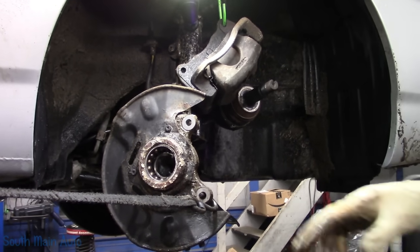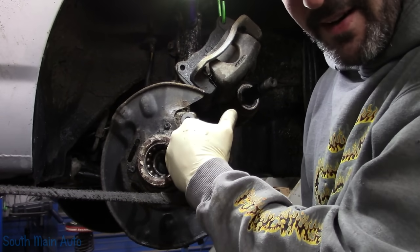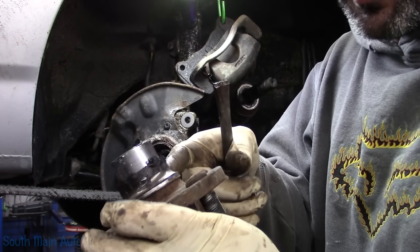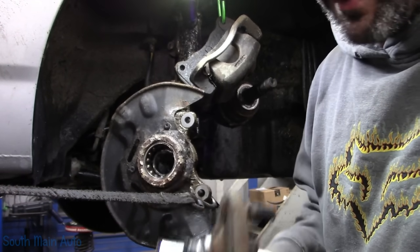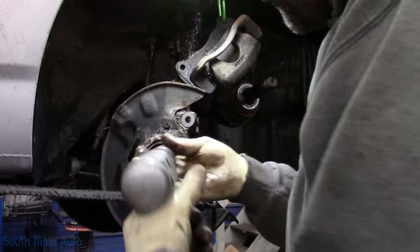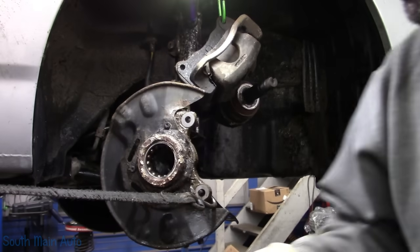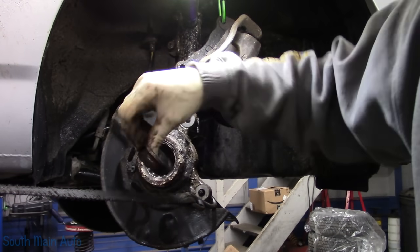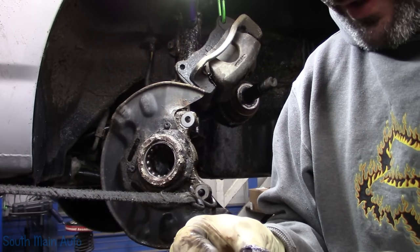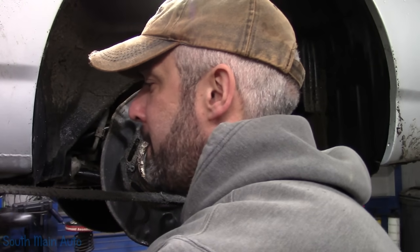So I'm gonna do it now because we're gonna use the hub tamer or hub grappler to push this out. But I need this bearing race. And I bought a whole hub kit for this one. Because typically, or otherwise, I should say, we would just salvage this race back off the hub. But what we're gonna do, I'm gonna see if I can knock out the inner one. Bing! Ow! Did you hear it? So we're just gonna take this, put this out here. Of course, it has a little seal piece on it still, which should come off relatively easy, I'm thinking. Put a little tap there.